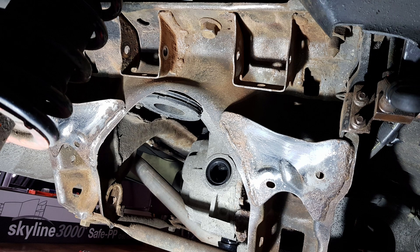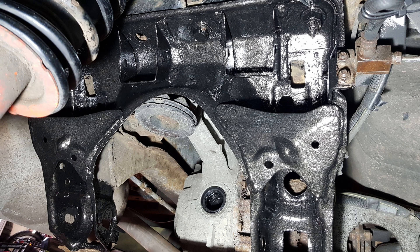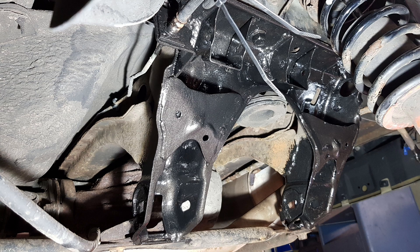Even though I painted these by hand I thought they came out pretty decent. Because I now had a clear view of the rear subframe, I thought I'd also remove as much rust around the mounting spots for the swing arms as possible. So I sanded it and painted over it by hand. For now this was good enough, although I thought to myself — well, maybe someday I'll just take out the rear subframe and get it powder coated or something. At least for now I wouldn't have to mount my nicely rebuilt swing arms onto a rusty surface.